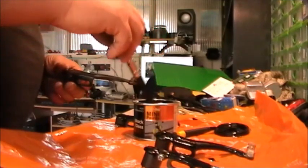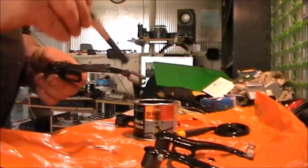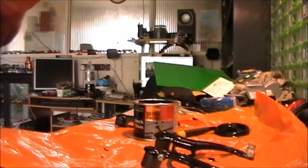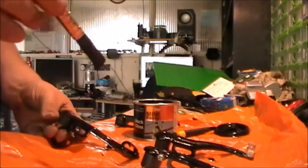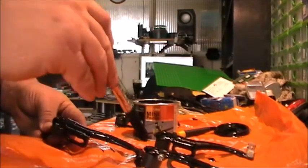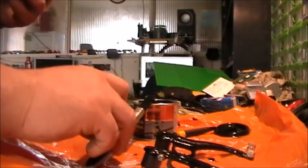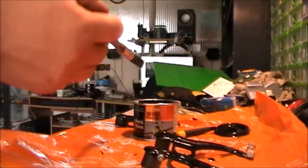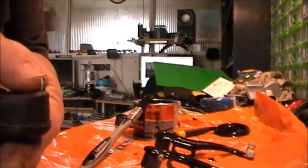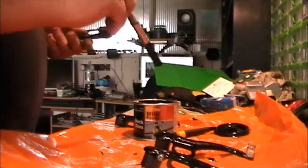See, this one's a bit rough, but I might as well do it now while I've got the paintbrush out. This one is meant to have a black noodle bracket, so I'm actually going to paint that one. These are only metal V-brakes with some cheap paint slapped on, just to make them look nice. They get a bit of rain on them and they rust. I'm also checking that these little pins that go into the frame aren't snapped on these, otherwise the springs are no good.